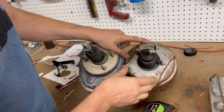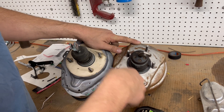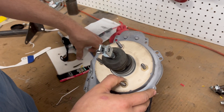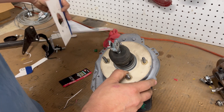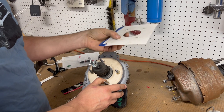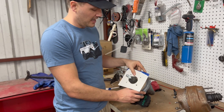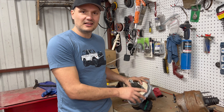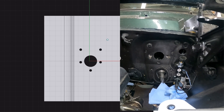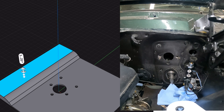For physical differences: where a '67 through '68 booster had a five-bolt pattern, this one has a four-bolt pattern with a different setup. I have a template made and will post a link to it — a simple template you can print out to help you center and show you where those holes need to go. The cavity for the brake booster is about an inch and a quarter recessed away from the rest of the firewall.